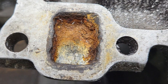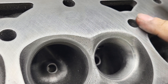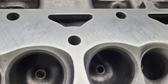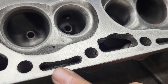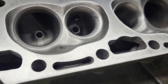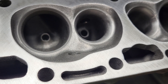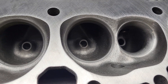My old dirty TPI intake that I did for testing different designs has much more generous front passages and it's closed off on the back. Another thing I like to do is just go over it with the longboard and make sure everything is right where it should be. Another thing that needs to be done - even though it's iron - is these edges need to be hit with a file, because even though it's iron, if you're doing porting with it and putting it on and off the stands, they can get nicked up, and you don't want a high spot to keep the gasket from sealing really well.